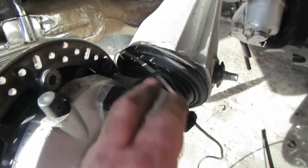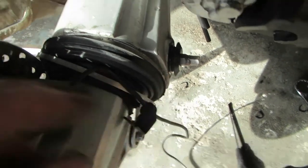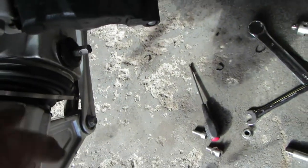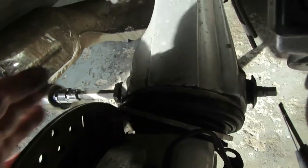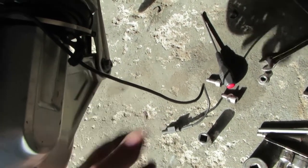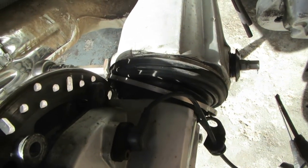So here we are then. I've removed the hose clip so that is now free. I've freed that off - that's now undone. I've freed that off and that is now ready to be undone. The ABS sensor has been disconnected, the caliper is hanging up comfortably on the side there, and this bolt at the bottom has been removed. So now what I'm going to do: remove that, remove that, support the weight, remove that bolt there, and then take the entire diff assembly out. Then we can inspect those bearings, have a look at them, and if necessary repack them or replace them depending on which way it goes, and then reassemble.